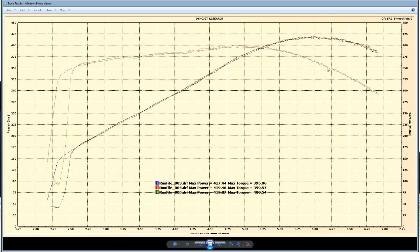The more torque you have at high RPM, the more horsepower you're overall going to make. This applies mostly to a two-valve naturally aspirated V8 engine. Now engines where you have a crazy amount of dual overhead cams and high airflow and really high RPM — you can compensate for not having as much torque and still get a ton of horsepower. Because when volumetric efficiency is good and you have an engine that can rev to 8,000 or 9,000 RPM and still flow air, you can overcome a lack of torque and make really good horsepower. But when you're talking about a big pig-iron American V8, two valves per cylinder, especially when it's naturally aspirated, you need a lot of torque up high to make a lot of horsepower.